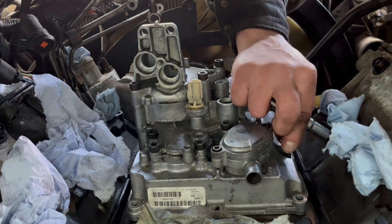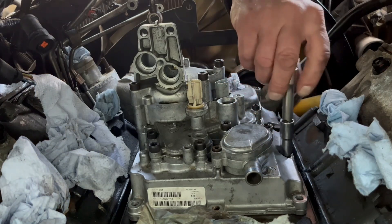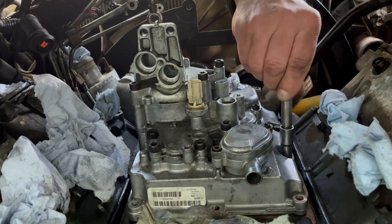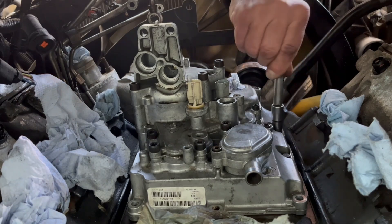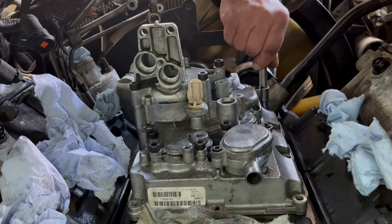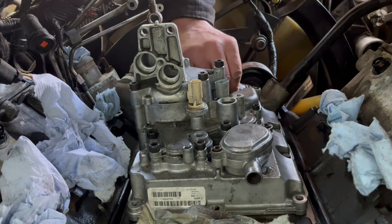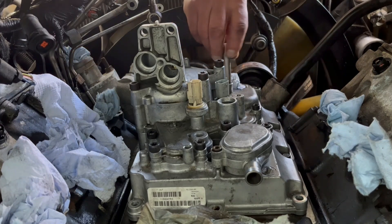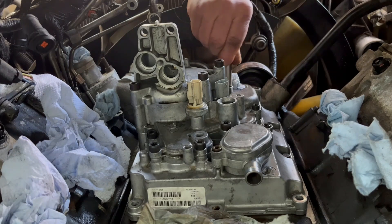This is basically the heart of the engine, because if you don't cool the oil properly it's running always hotter, and then you're gonna have lifter issues. The bearings are gonna crack — I've seen it not once but many times. The lifter just gives up, grenades the whole thing, destroys the cam, and then it's a pretty expensive repair.